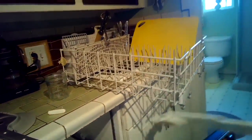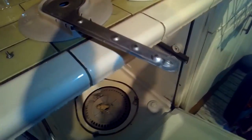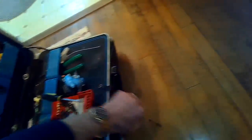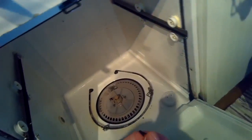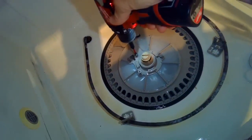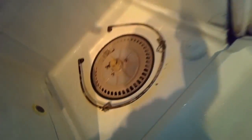It unlocks at the bottom — lift it up and pull it out of the way. There's another Torx 15 screw hiding underneath that spray arm that I have to remove. It's actually a pretty good procedure to do about once a year to clean out all the junk that accumulates underneath the filter assembly. Another shard of glass. I'm starting to think there might be stuff rubbing against the impeller because of all the evidence left here above the filter.